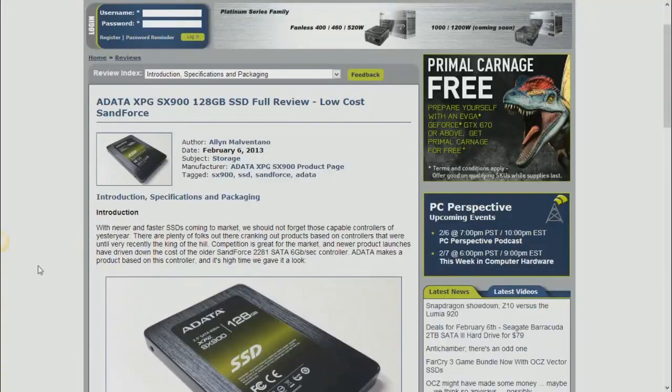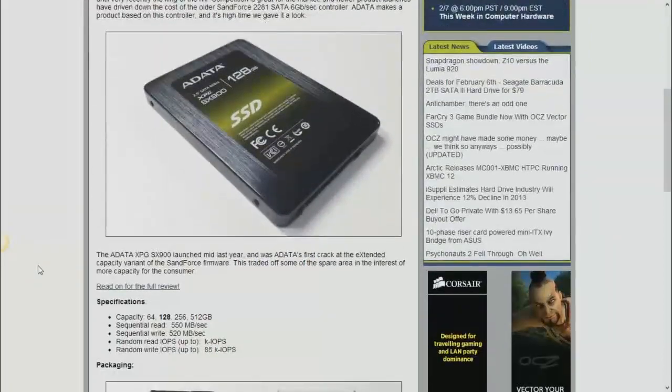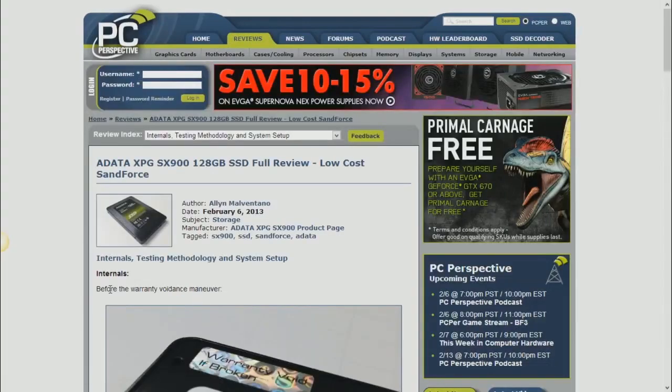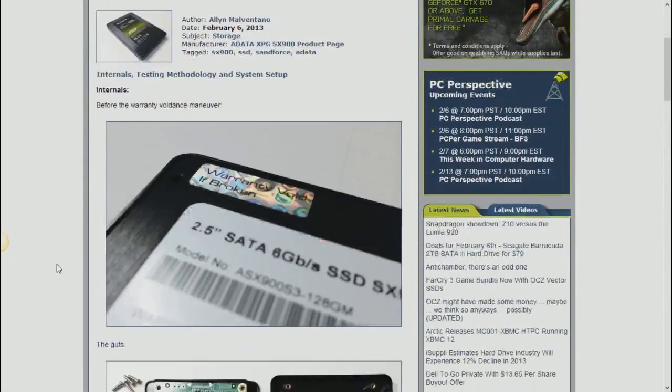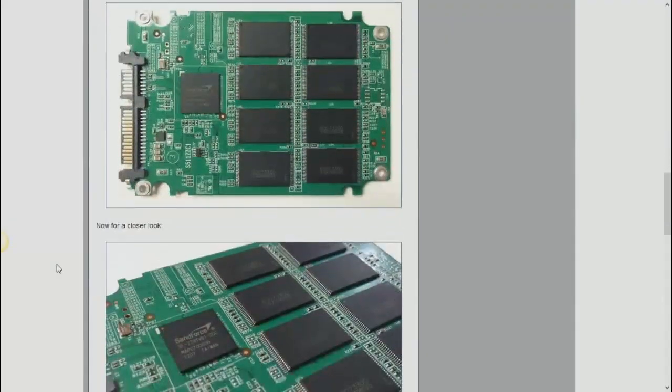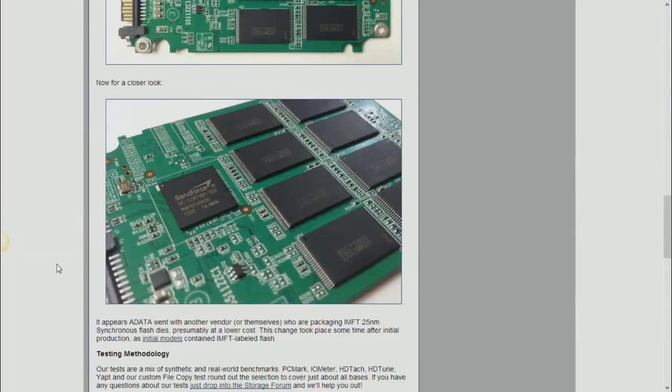Let's talk about Alan's SSD review posted today — the ADATA XPG SX900 128GB SSD. It uses a Sandforce 2281 controller with standard base firmware from Sandforce, not heavily optimized, but still decent. Firmware updates are available from ADATA as of about five or six months ago — the non-automatic-bricking version. Those firmware bricking days are pretty much in the past; we haven't seen drastic failure reports for a while.